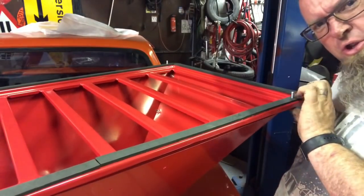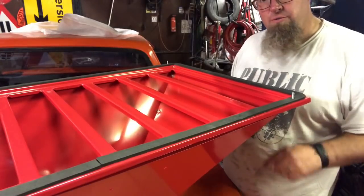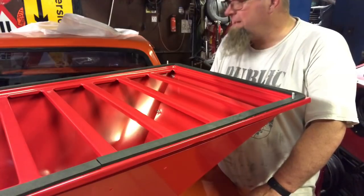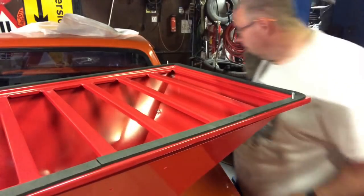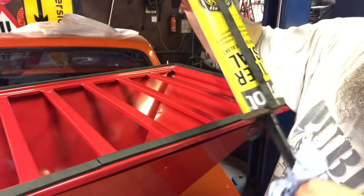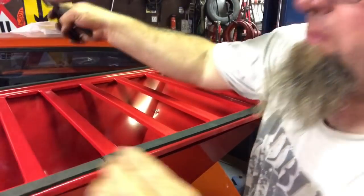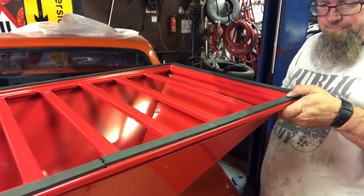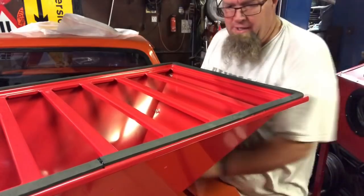You've got to push these bolts through two pieces of little foam, which hopefully should hold it together. I'm kind of hoping to slip that under there now, although I've just realized I've got to take it all back apart again because I want to put tiger seal down all those corners. I've also noticed the join in the rubber — it's got quite a gap there, so that's going to get the tiger seal as well. Let's do that now — squish this in the gap. There we go, that gap's filled. I've got to do it because I can't do it once it's all assembled.